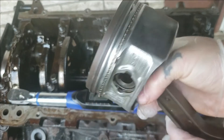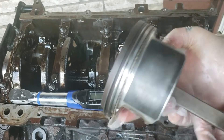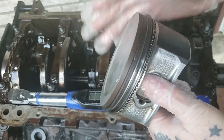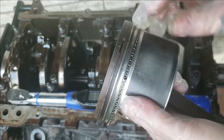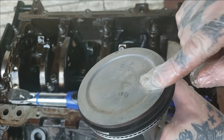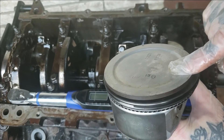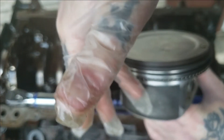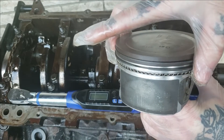I'm going to give this to my helper and they're going to spray this piston off with brake clean. But first I'm going to show you how to line your rings up. This is how I do mine. This dot is pretty much the front of the motor — you've got a load well right here. You don't want to line your rings up in the center.